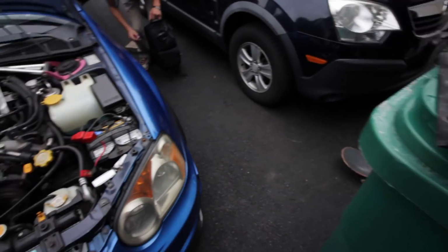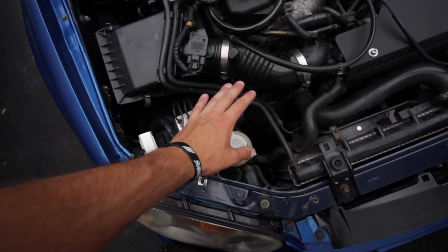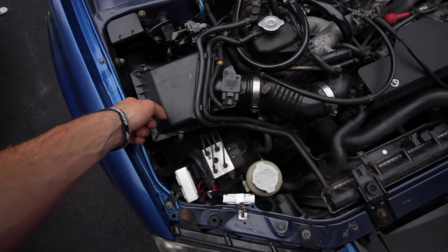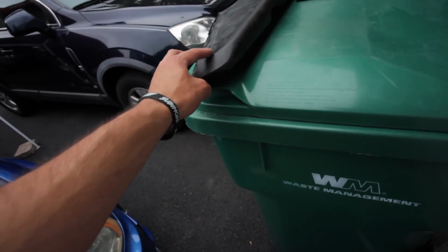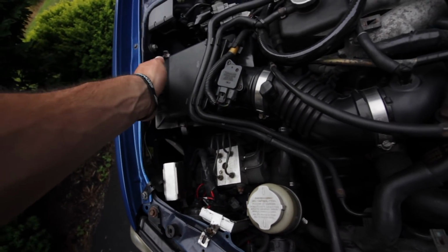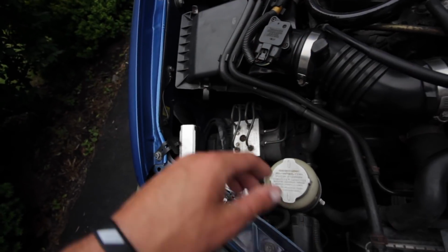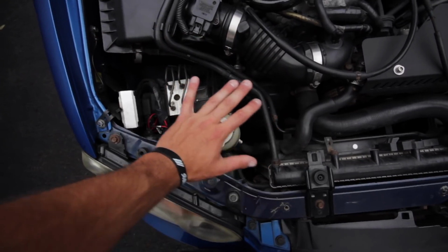A thing that we did a couple years ago when I first got the car was we took out this little intake piece over here, which goes down, feeds into a big tube and then back up into the intake. Took that out to make it less ugly. It sounds better, but I think I'm gonna replace this piece, clean it up a little bit, and throw it back in. Since the intake is sitting in the fender, this part will shoot in colder air, which will be sucked back up, and we can still hear the intake. Then I'll block off all this stuff right in this area.